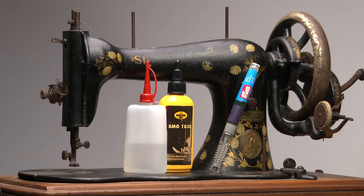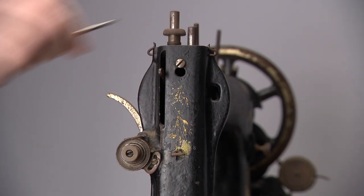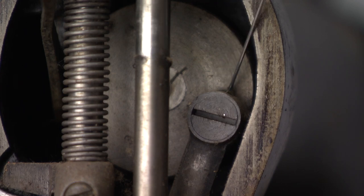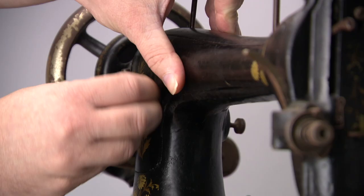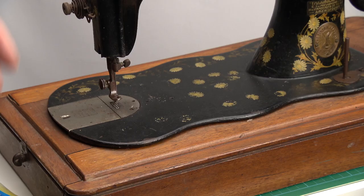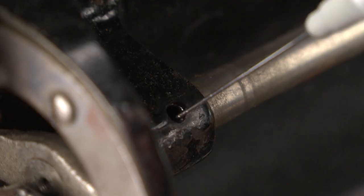Like every tool, you need to maintain your Singer sewing machine once in a while. Deposit a drop of sewing machine oil in the holes of the machine. Only one screw holds the plate on the short side on your left — wherever anything hinges or moves, deposit one drop of oil. The same goes for the inspection plate on the rear — one screw, one droplet, and done. To finish, tilt it on its side and oil multiple points.